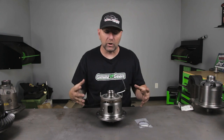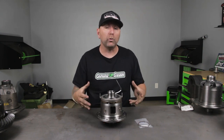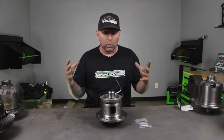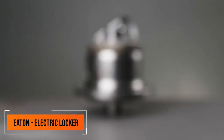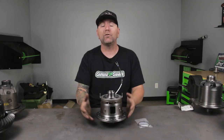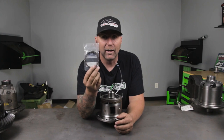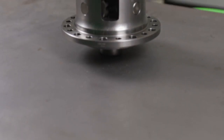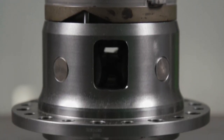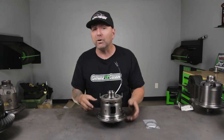This is number four and this locker looks really cute because it's not for a van — this is actually for a Jeep. What I'm talking about is an e-locker, or electric locker. It has electrical leads that go to it and it's going to be engaged only when you want it to be engaged, and that is what people love about this e-locker. It's going to have less moving components or parts that could go bad, like seals in an air locker. It gives you power to both wheels when you want it — you turn it on, you turn it off. Simple as could be.